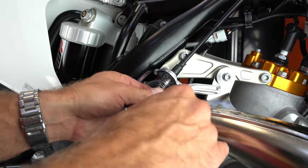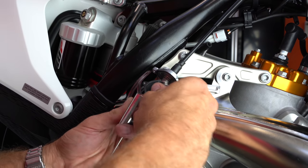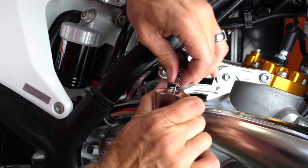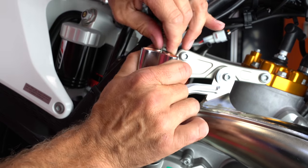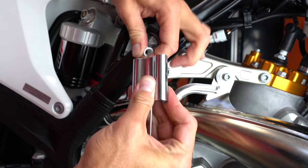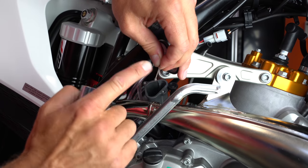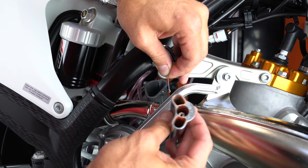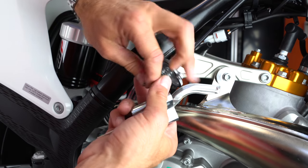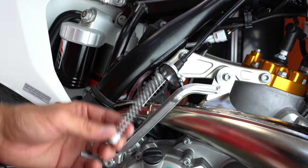This is the slide, and this is the needle. To remove it, I pinch the spring and there's a little catch inside — the end of your throttle cable comes off that little keeper down inside there. Once you get that off, you're good to go. Don't let that spring go flying — we're going to need it later.